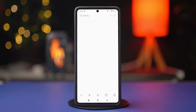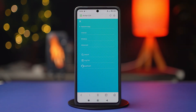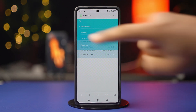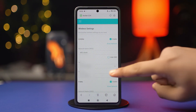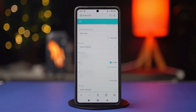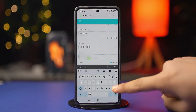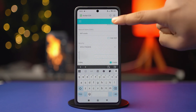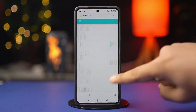After that, you should be able to log in. Once logged in, tap the three-line icon in the top left corner, then tap wireless settings. In here, you should be able to change your password. Find the password box in the 2.4 GHz section and tap on it to edit. Once you are done changing the password, hit the save button at the top. You should be disconnected from your Wi-Fi after this, so just reconnect all devices using the new password.